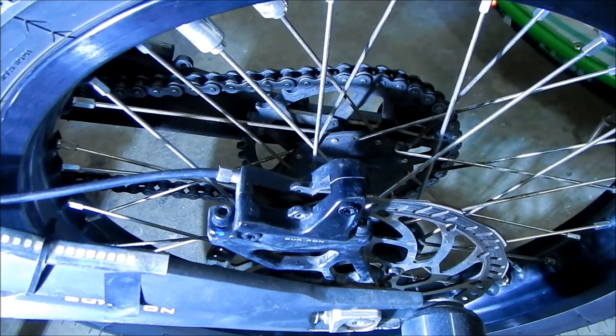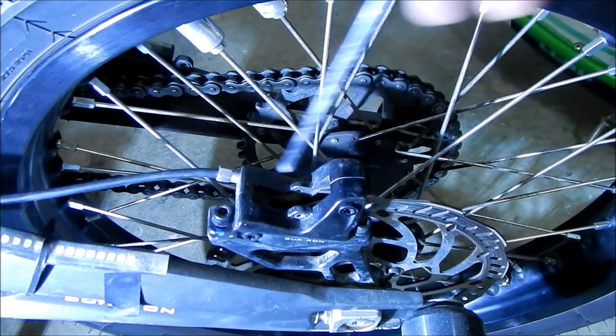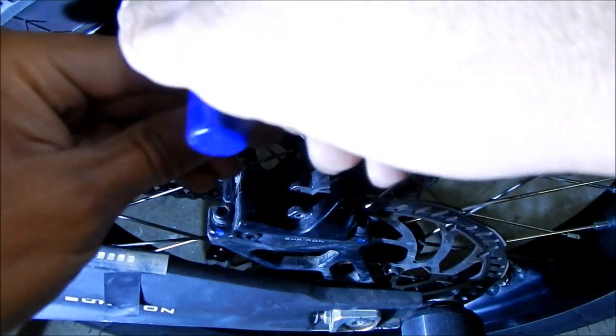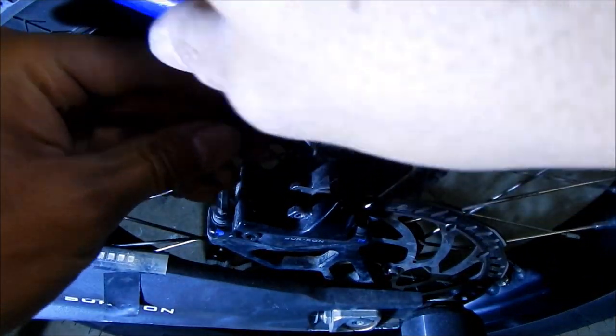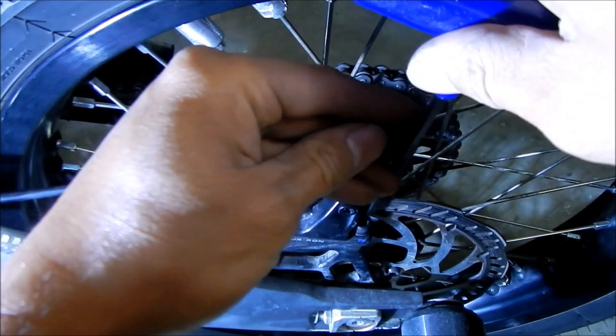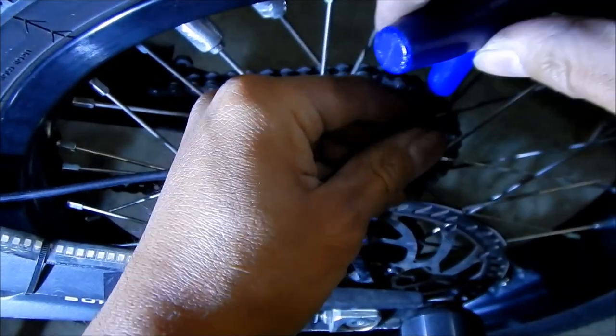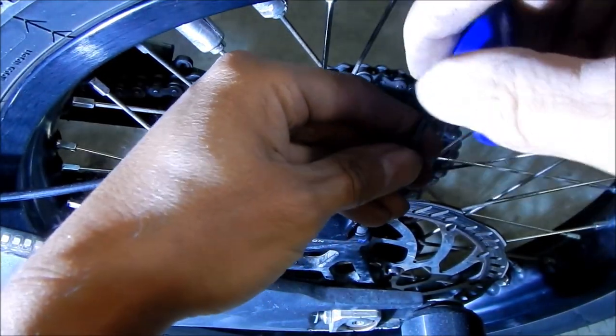What we're going to have to do next is push the pistons back in, and to do that I suggest you take the caliper off — you're going to have to realign everything anyway. Take your 5mm Allen wrench and loosen the screws and remove the caliper. It's kind of better if you use a normal Allen wrench rather than the T-handle.